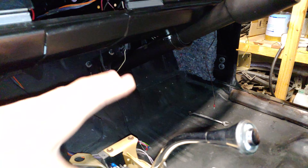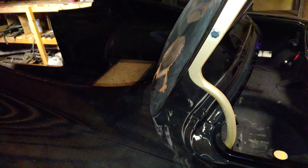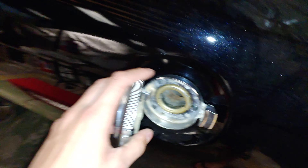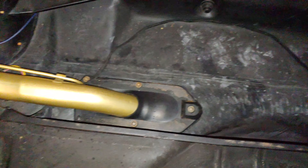I also mounted the plate for the brakes and the plates for the horns, just because I was bored really. For the interior, I finished the inlay — just need to clean it up a bit. I also mounted the steering column; it's not fastened yet because the steering box needs to go in first and be attached to the column before you can fasten all of this up. I haven't done any other insulation work yet — maybe we can do that in this video. I also finished the wiring to the back — it goes all the way through nice and tidy. The little blue one is fed through for the fuel gauge.